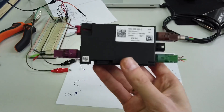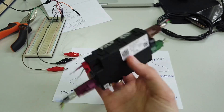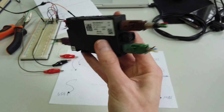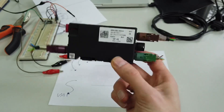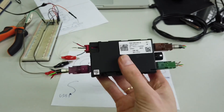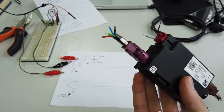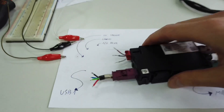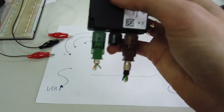So over here I have the USB hub. This part is pretty much the same for most VAG vehicles. This one was taken from a Volkswagen Polo, but the same part will be found in Passat, Arteon, Tiguan, Golf Mark 7, and so on. This cost me about six or seven bucks. It's used and those connectors were included, but the wiring is damaged - it's cut - but I was able to use my multimeter to check how the pinouts are organized.